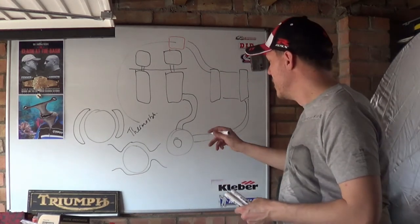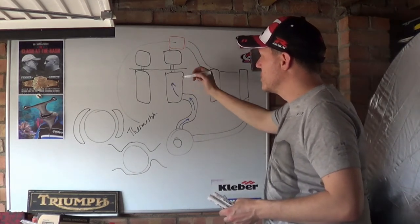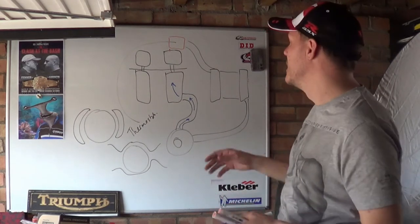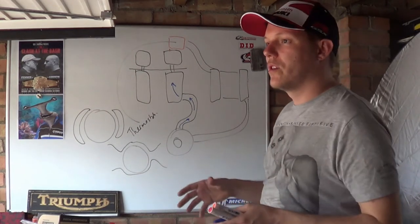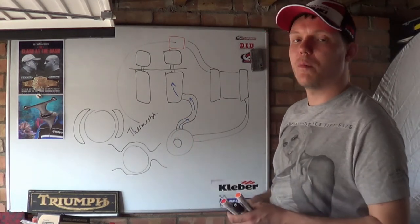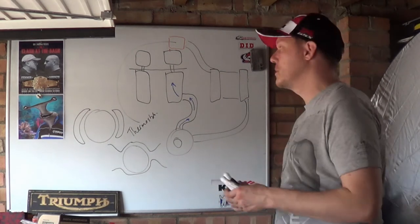So obviously we have the pump to circulate everything around the system, and water goes into the jacket, or there should be water already in the jacket. Now this water is the same temperature as outside and the rest of the machine, which is at 0 degrees. The problem with running engines at 0 degrees is the oil and other components that we have. There's thermal expansion, and the engine gets hot anyway because of all this waste heat, and the oil will not work properly at that temperature. We need the oil to be hotter to lower its viscosity so we can squeeze it between bearings and have it do its intended job.